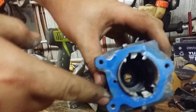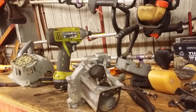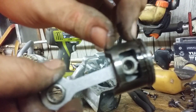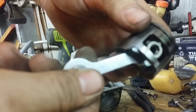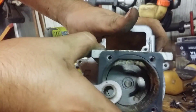I can pull the cylinder head off. You can see there's a little big gasket there, and you can see down in the bore — pretty nasty in there. Honestly this one's not in terrible shape, it's not all scarred up, but toward the top it's junk. Here's your piston. We have our piston, first and second compression ring, this is your keeper, the little spring right there, the wrist pin which is what it moves on — same deal on the other side. This is your connecting rod, this is your bottom end bearing with a needle bearing because it's a two-stroke, and that connects right here to your crankshaft. So when the engine's running, it's doing that.